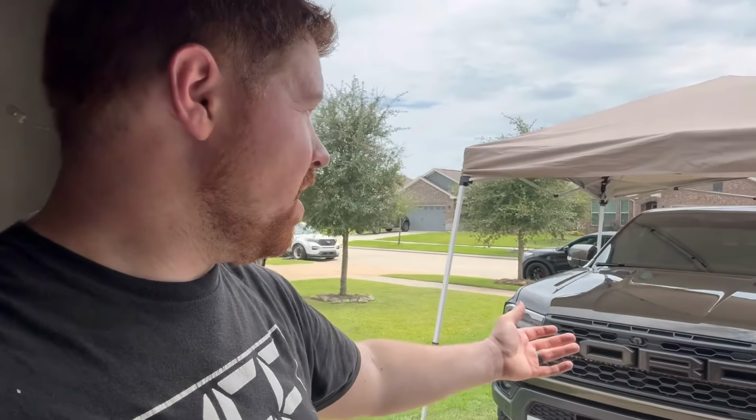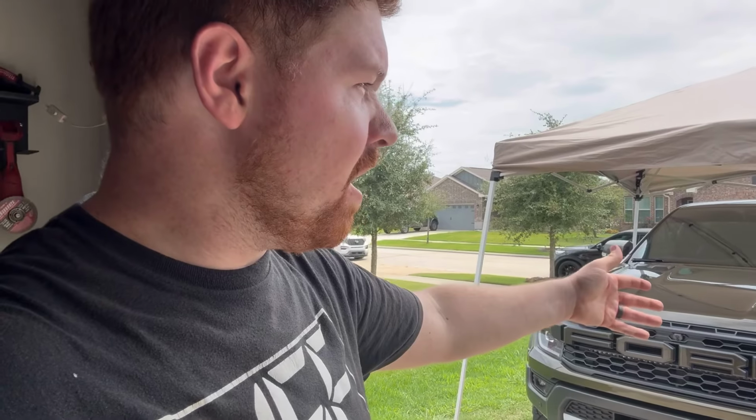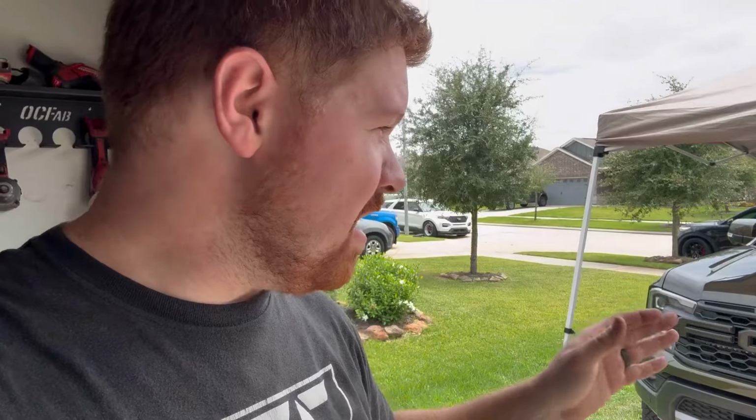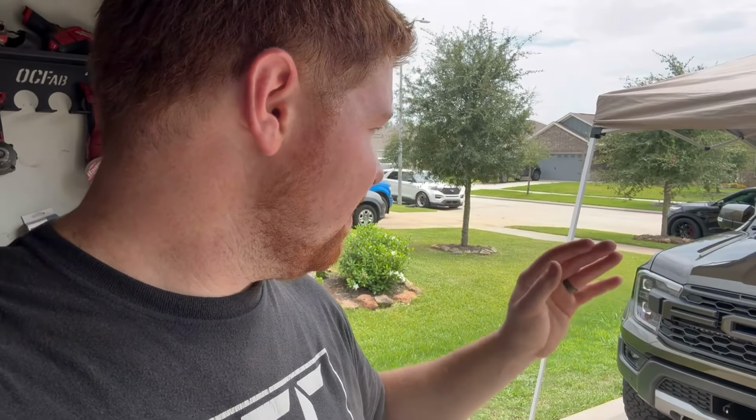Now we're gonna hit the dyno again. We made what, 390 horsepower and 497 or 98 foot-pound torque, almost 500 foot-pound torque yesterday, bone stock. We did intercooler, SMD intake, and Fenfab downpipes. Let's see if we can get into the 400s. Should be really easy today, especially with the intercooler helping us from getting heat soaked. And intake and downpipe should only add power.